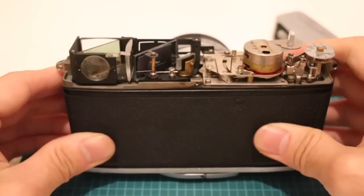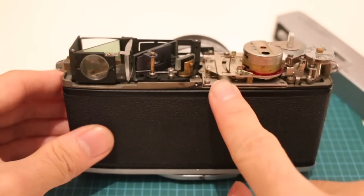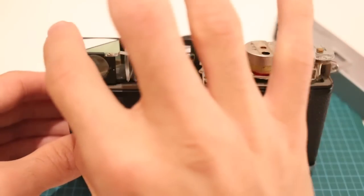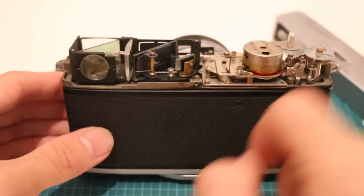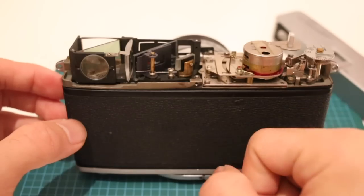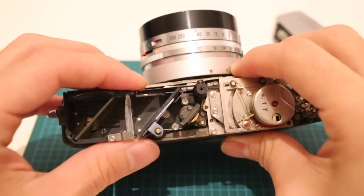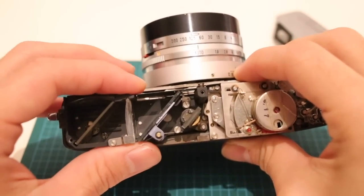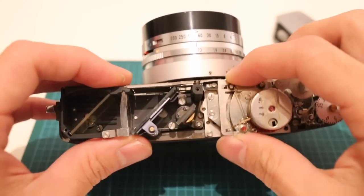One of the things that really revolutionized why this was particularly repairable: you'll notice that on this side the metal is sort of light, and on this side the metal is sort of dark — and that is for a reason. This entire assembly for the viewfinder is completely modular and separate from this assembly, which handles all of the shutter and count mechanism. To demonstrate that, I've taken off three screws and you can see that this entire assembly is effectively removed and separate from this particular part.